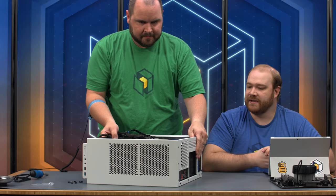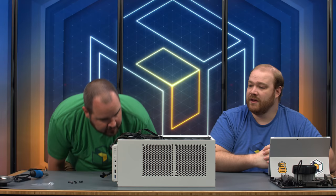A viewer asks what parts to put in first. Generally: IO shield, then a toss-up between motherboard and power supply depending on case size. The bigger the case, the less order matters. After that, hard drives, then connect all cables. Generally the last thing is the graphics card — it sits in the middle with one or two plugs and is very simple. If you have an AIO, get the radiator in before the graphics card.